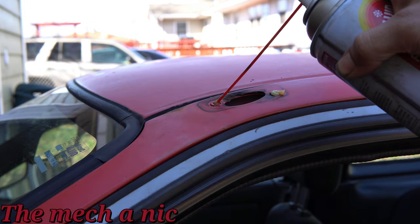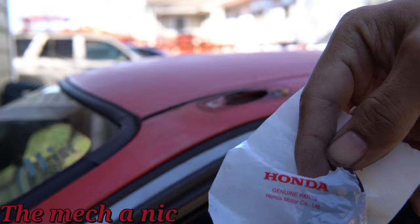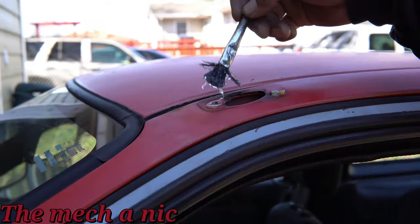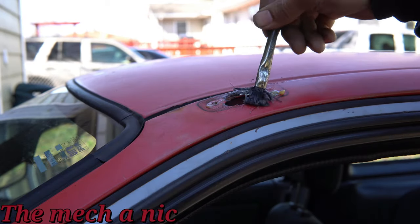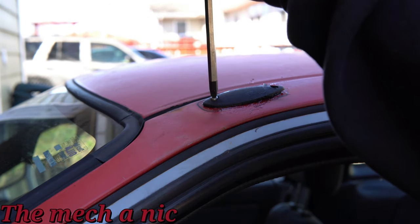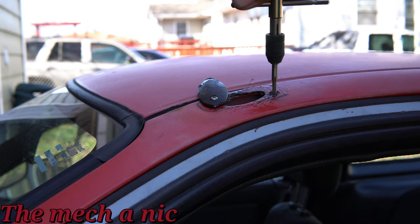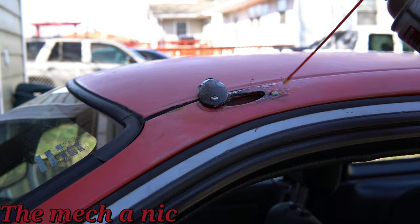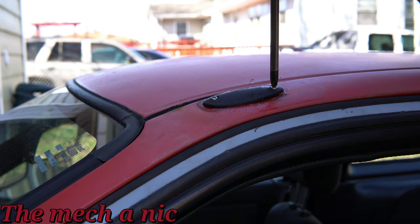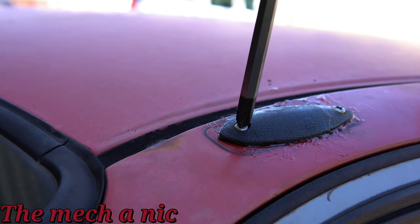I think it just makes the car look a little bit cleaner by putting a block-off plate out here. Now there is a gasket for this block-off plate but good luck finding that, so here I am applying a little bit of dielectric grease to try to prevent some moisture or water from getting inside. It's not a big issue because I mainly keep the car in the garage. I found out that the threads were kind of mangled up for the screw, so I just ran a tap in it and fixed that right up and was able to put the screw in without any problems. As far as the gasket, it looks like I'm just gonna have to buy a small sheet of rubber and make my own — I'm not really worried about it.